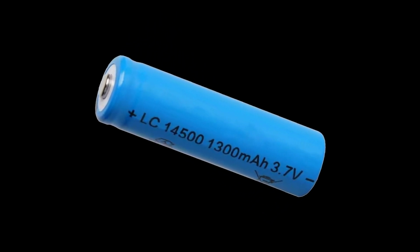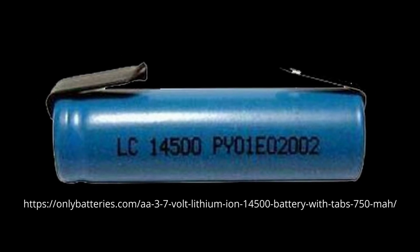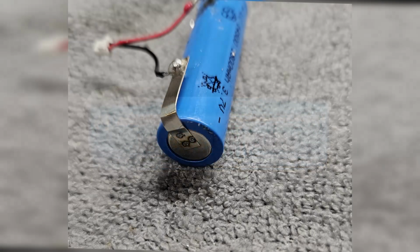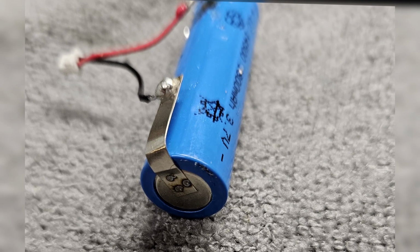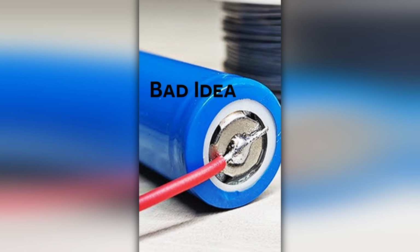Now, since you probably don't own a spot welder, another option you can use is to order a battery with these tabs already in place. Check the link below for an example. You'll still need to solder the old JST connectors onto the tabs. Personally, I was unable to locate a battery of this size with the correct connector already in place. The thing you want to avoid is soldering directly onto the ends of a LiPo battery. The heat involved when soldering directly to the ends greatly degrades the battery.